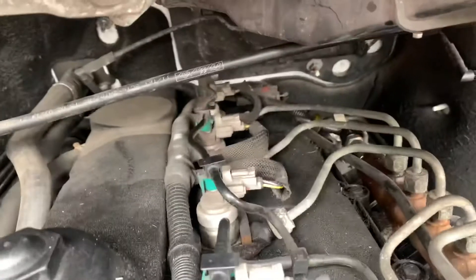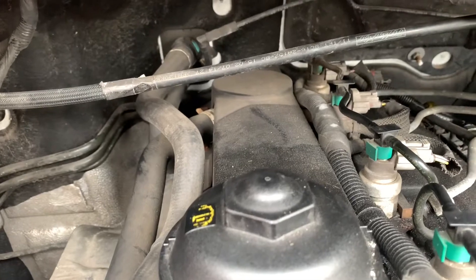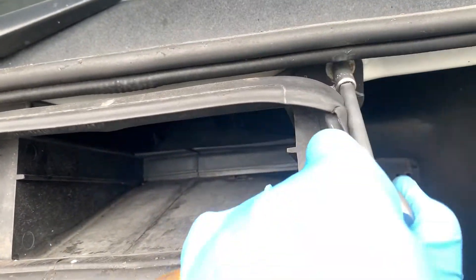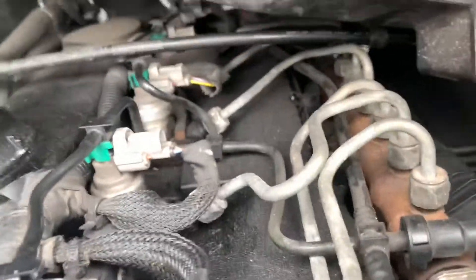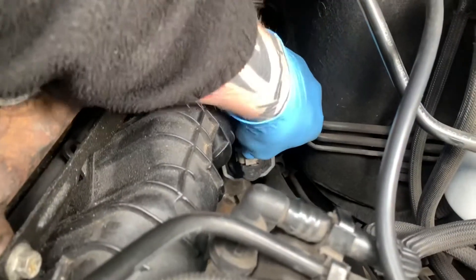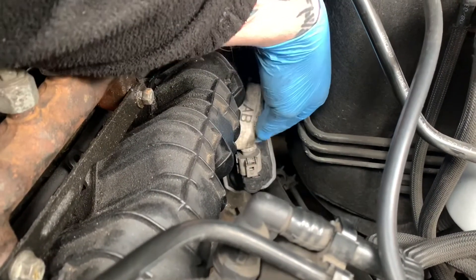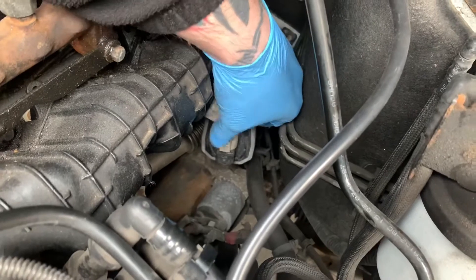What I'm going to do is take the EGR valve off first and then unbolt it, and hope for the best. So wish me luck. The initial part of this is going to be to take this off, which is two 8mm bolts and then it just pulls off. Disconnect the plugs which just click out. Now do you like how I am talking about this as though I know the correct way to do it, as though I've done one before?